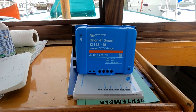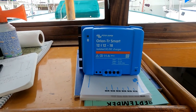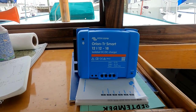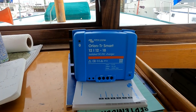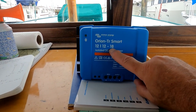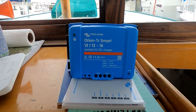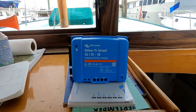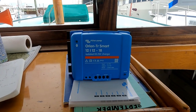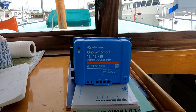The main reason for this is that lithium iron phosphate batteries have very, very low internal resistance. By isolating the lithium iron phosphate battery from the alternator with this charger, I can limit the charging rate to a level that will not stress the alternator. This particular charger has an 18 amp charging limit; for a short period it can go up to 25 amps, but for normal longer-term charging it limits itself to 18 amps, and my 110 amp alternator can handle that easily even at idle engine speeds. So this protects my alternator and also provides the correct charging profile for my lithium iron phosphate battery.